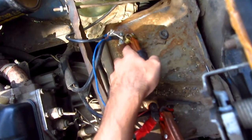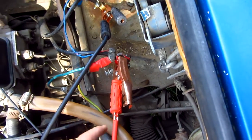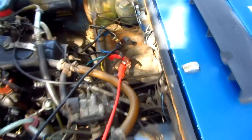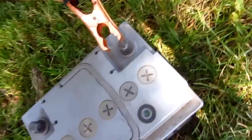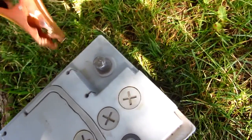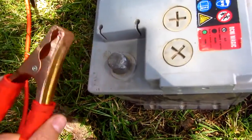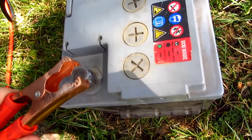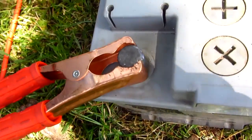The minus can touch the body because the minus is grounded to the entire body of the vehicle, but the plus must not touch anything related to the car's body. That's connected. Now let's connect the black one — it's the negative, it says negative there. And this is the positive. First, let's do a quick test — a short touch. There are no sparks, which means the connection is good and there are no short circuits.